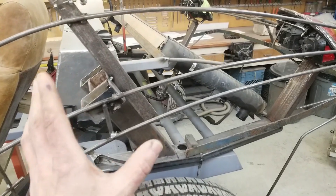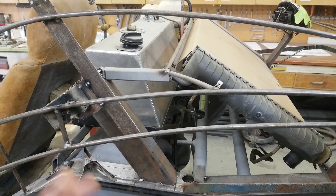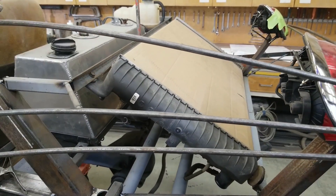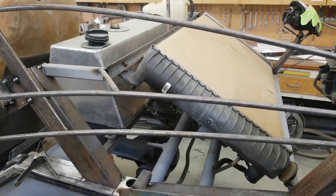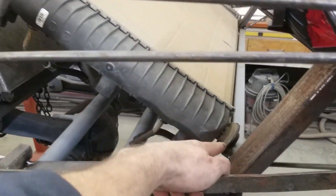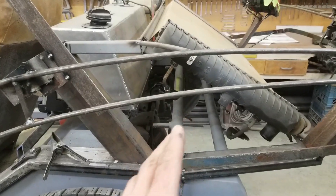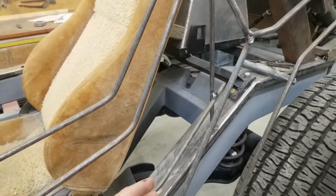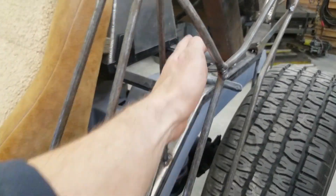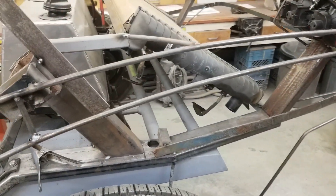The fuel tank is custom built to work in this area. It works with all of our signature style frames — the platform, everything has been developed. This is a mule tank, basically what we use to mock things up. We're going to have to relocate the filler neck. What we have here are the cooler lines as well as the coolant lines, one here and one on the other side, fixed in place on rubber mounts at the bottom and on the top. To get air through that rad, we're going to have a scoop on the bottom of the car as well as through here. The air is going to flow between this exterior panel and the web, right through there and through the rad. It's going to be a lot like the GT40, the newer style GT40.